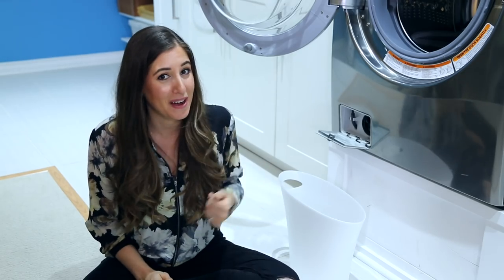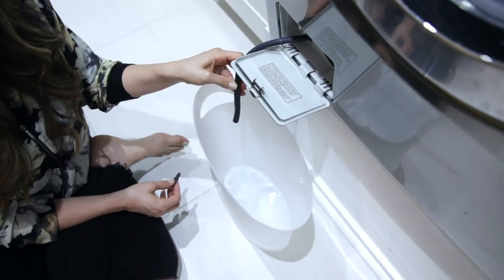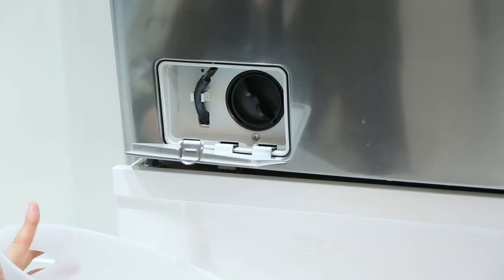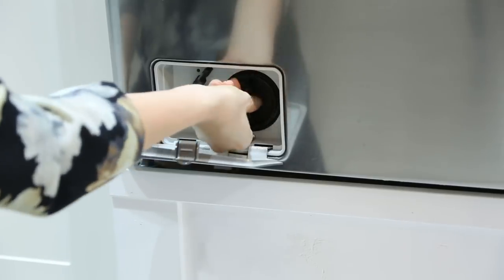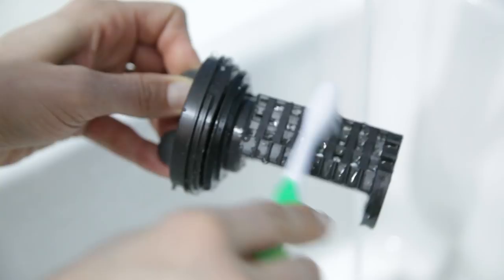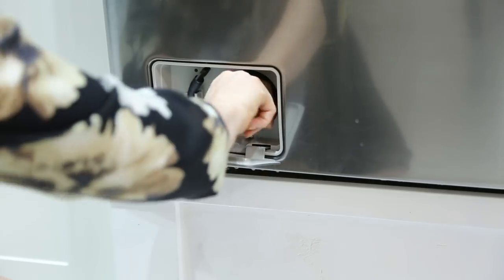Now after watching this, you'll know how to do it. Step one is to find where this thing is located. Once you've done that, there's a hose — pull that out and then loosen the plug. Make sure you have a bucket because this thing is going to drain. I got over a liter of water draining out of this thing; it took a while. Then screw it back on and put the hose back — there's a little clip, you can put it right there. Now you'll unscrew the filter. Mine doesn't look terrible, but there certainly was a little line of scum, which was revolting, and a big chunk of dust. I used a cleaning toothbrush — I didn't even use dish soap — and just gently brushed out all of that schmutz. Tap it off and then stick it back in. It's pretty easy to do; it took me less than three minutes.